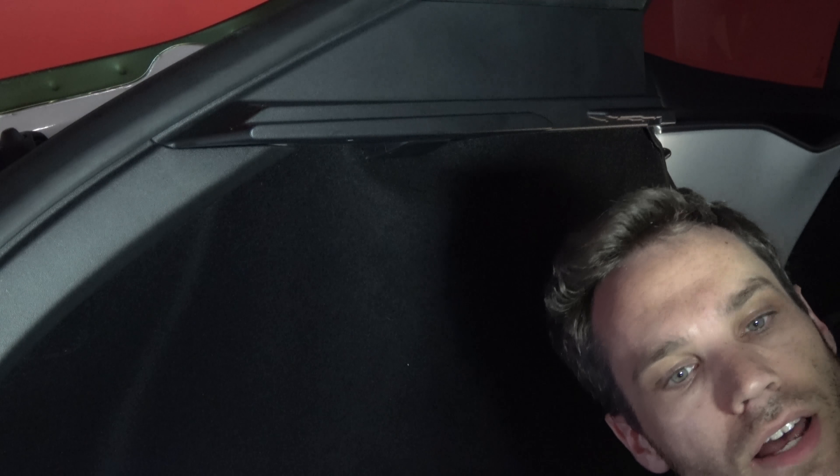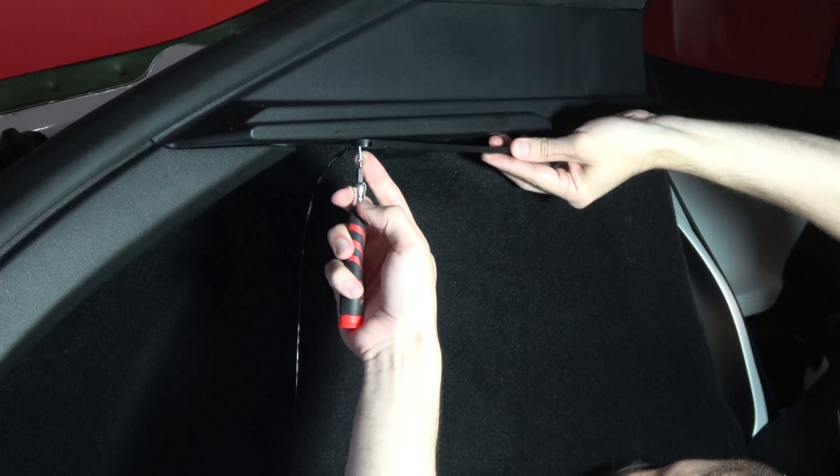Let's go ahead and screw this one in first — the screws are very small, so be careful you don't lose them. Looks like Norm included five in case you lose one. I put down my rear seats and laid on my back to give a good camera angle. What I did off-camera was mark the holes by pushing the screw through them, then drilled a 1/16-inch pilot hole to guide the screw in the right direction.